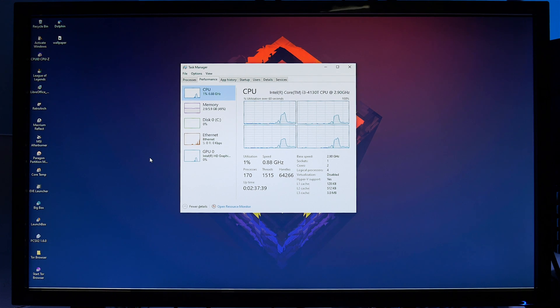OK guys, let's test this thing out. So we've got the Lenovo M83 with the i3-4130T processor, maximum frequency up to 2.9GHz — it does this with two cores and four threads. I could have upgraded this chip to an i5-4590T, which has a base frequency of 2GHz and boosts up to 3GHz with four cores and four threads. These cost around £40 on eBay — it's an option I might consider further down the line.